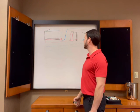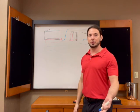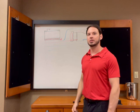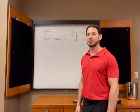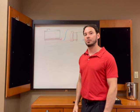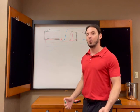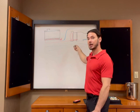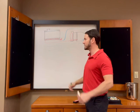Almost all of these transmissions that fail, I will tell you, how will you know that it's bad? Man, that first 2 to 3 shift is trash. Shift flare, kinds of bad stuff. Once the fluid's warmed up, it shifts okay. Why is that? Because when the fluid's cold, it's bleeding this pressure down, the fluid is thicker, it's just a bad situation.